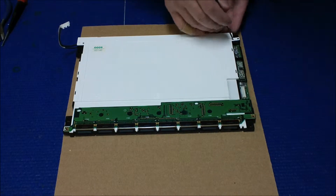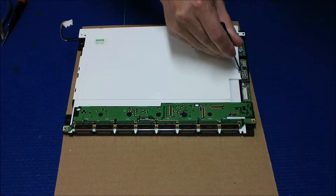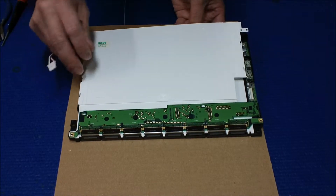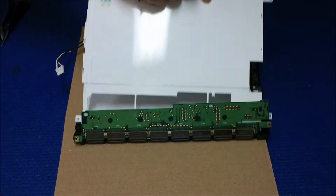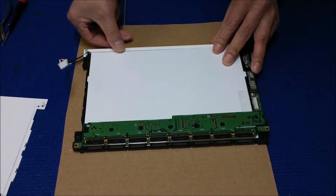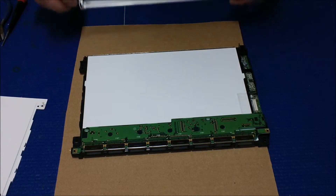The plastic has clicks here on each side. You're going to hold like this, get your hand behind, and go like this to release each click. Take it out. Now you can see the back lamp wire here. You basically just pull the clip that way and pull the wire out. Now it's out. Let's set this aside for a second.